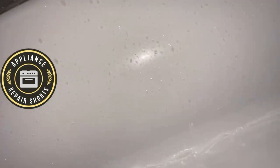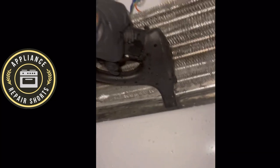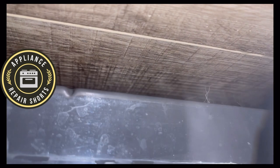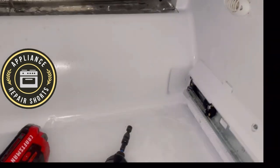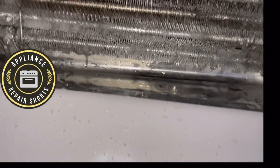I want to jump back in and say I didn't show the dismantling. For the freezer door: pretty straightforward — two screws on each side, remove those, the door lifts off. Then remove the bins and you're in the freezer. The freezer cover is two quarter-inch screws — pull the panel forward and you're in. Just be careful of the fan when you get into the freezer.